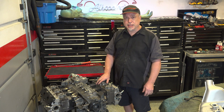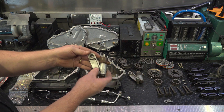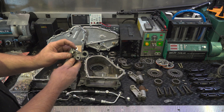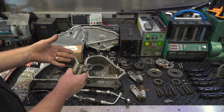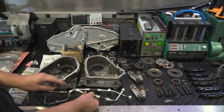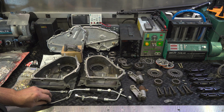I have it laid out here to show you what the kit consists of and how much work this is going to be. The main goal is to get rid of the mechanical tensioner. Instead I'm going to be using a hydraulic tensioner that steals a little oil from the oil supply, runs it through some taps, and supplies these tensioners — kind of like a controlled oil leak in the engine. The kit comes with hard lines, rubber lines with taps in them, and two covers for the hydraulic tensioner feed holes.